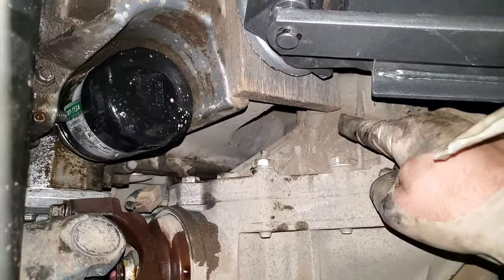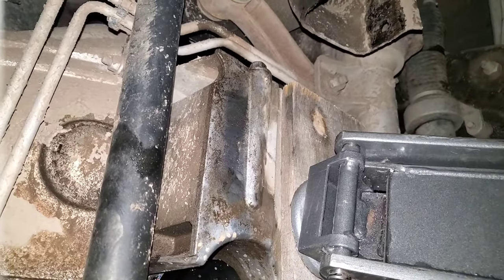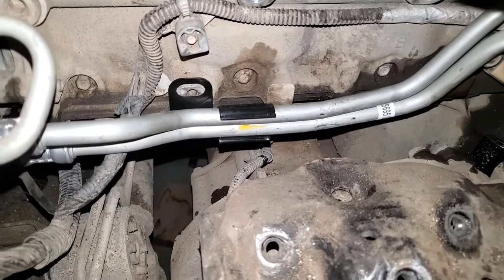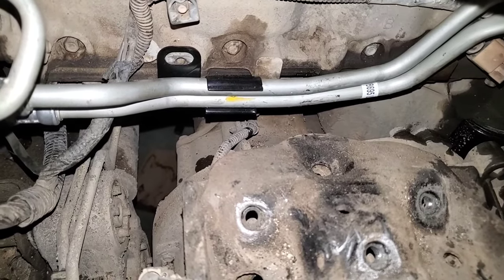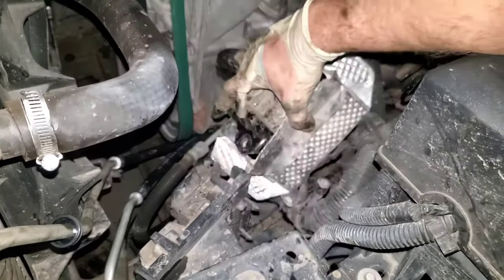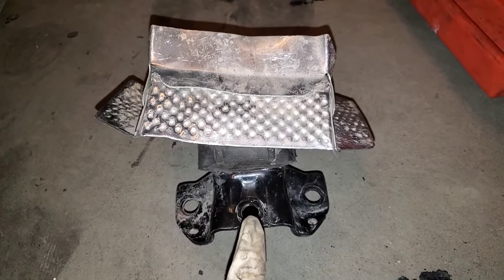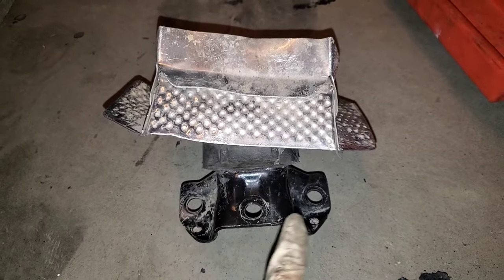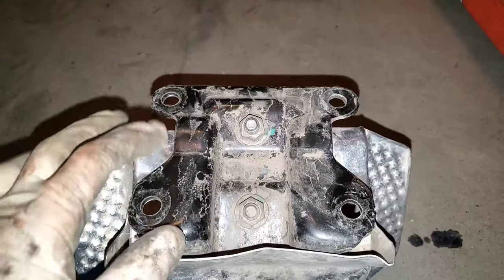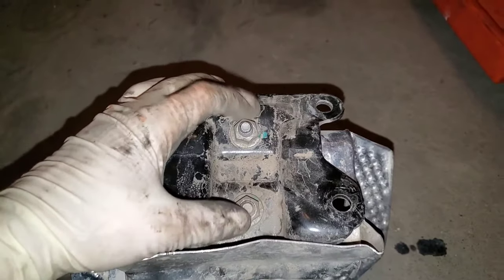Here's that new block of wood. Remember that 4x4 interfering with the axle? I had to go with a 1x6. You might have a bolt that holds this bracket into the side of the block — I didn't, probably because Redneck Randy who fixed this before me got rid of it. Then the engine mount — these are the three bolts that attach the engine mount to the frame. That's your heat shield, and then your engine block would be up that way. These four bolts here connect the bracket to the engine block, and those two bolts hold the actual engine mount to this bracket.